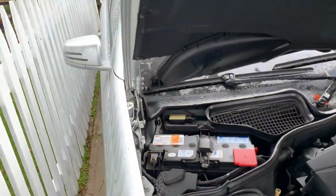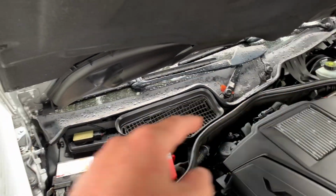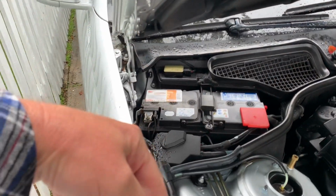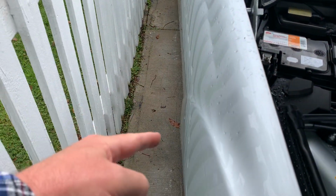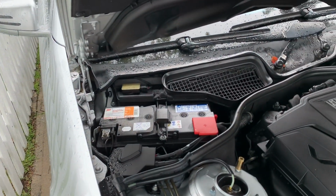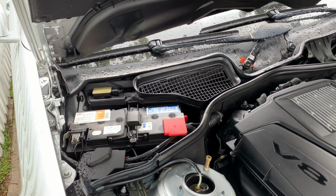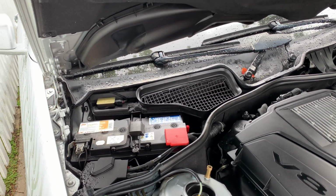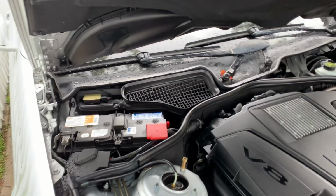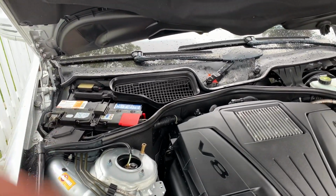See, when you poke a fish tape down in these drains, this one and the one over there, it kind of bottoms out in that pocket back behind that little hole that's located behind the back tire. So you're not really doing anything. You're pushing anything that was in the pipe down into that pocket, and then the pocket just fills up. You'll never get it out of that pocket unless you remove the fender well and scoop it out with your fingers.